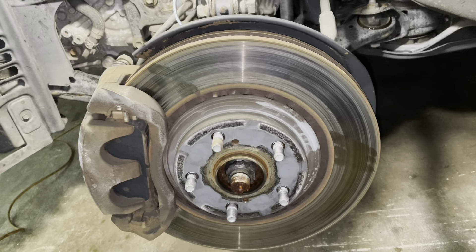In order to remove the brake caliper, there are two bolts — one 14mm here and one below. There are also two brake caliper bracket bolts, one here and one down there. To remove them you'll need a 17mm socket. I'm going to start loosening these up.